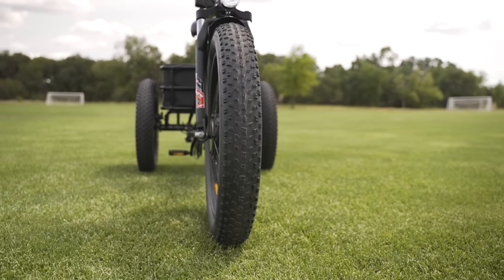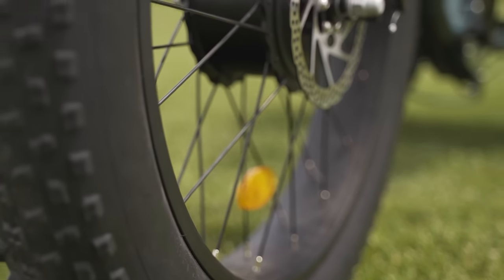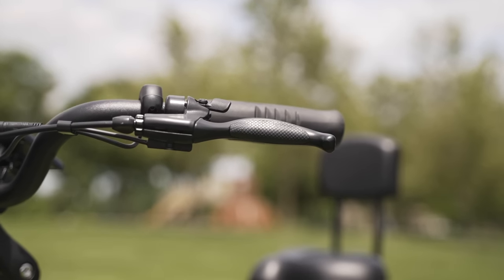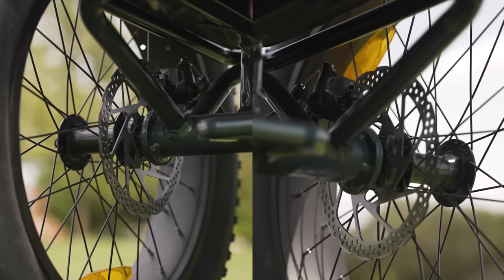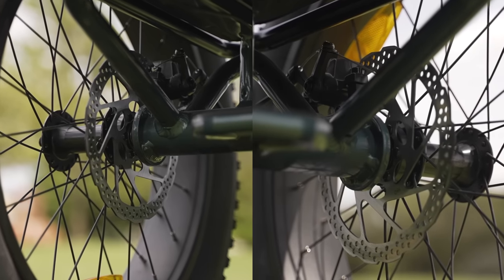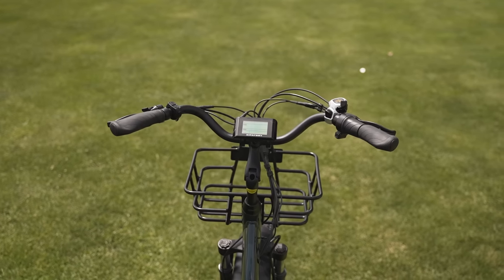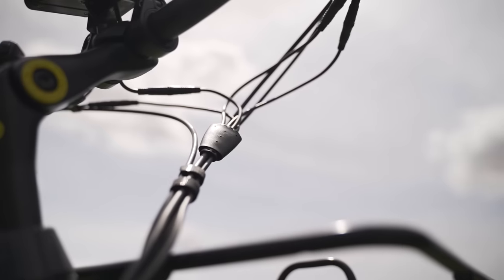This makes for a soft ride on pavement and offers enough suspension for some light trail use, but again, trikes are tippy so stick to graded trails if you can. When it comes to stopping power, the MF30 has mechanical disc brakes with 180mm rotors in the front and both rear wheels, for a total of three disc brakes instead of the normal two. But even with that extra disc brake, the stopping power is a little underwhelming — hydraulic disc brakes would have been a better choice.